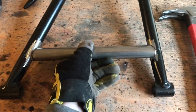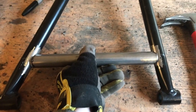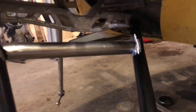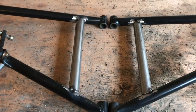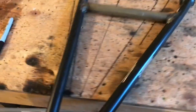We've got two cross pieces that are going to fit right up in there. I have them generally to size, but we're going to put the a-arms back on the sled and then weld them on the sled — just to make sure we don't get any sizing issues. So temporarily put the a-arm back in, ran a couple bolts through, set the cross piece in place, then tack it, pull it off, finish weld it, and do the other side. After you've got those tacked up, go ahead and finish welding, then we're going to move on to making the cuts.